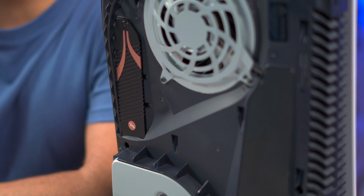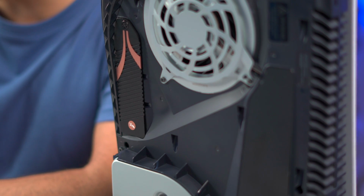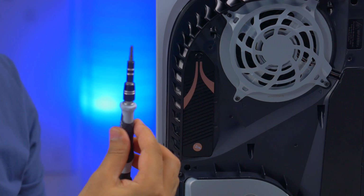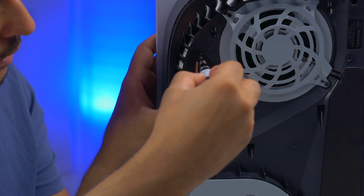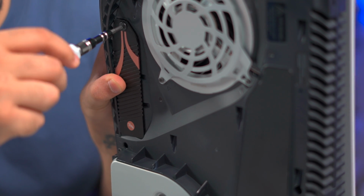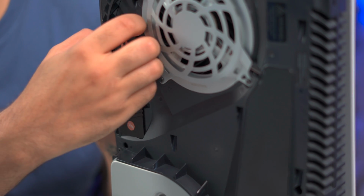So if you didn't watch our first video on this, the PS5 heatsink replaces the metal cover. You cannot install both. The heatsink uses our sandwich design so that, like our SSD enclosures, ensures a good pressure on the SSD for optimal heat transfer. Now, the thermal pad used is reusable and easy to remove and install if you choose to upgrade the storage or to remove the SSD entirely. The whole process is easy. The thermal pad sits in between the heatsink and the SSD for even contact.